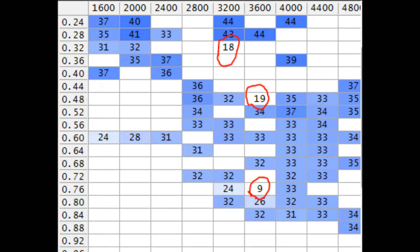And when you hit the throttle right off the bat, it's like it's delaying and not catching where the timing should be. So this is why I suspect the crank position sensor. I've checked everything else. I have the wideband wired into the scanner. So, and my math's a little off, but it still reads close enough to know if you're lean or rich. And that looked good. I mean, the plugs look good. The injectors look good. I highly doubt there was an intake gasket issue.